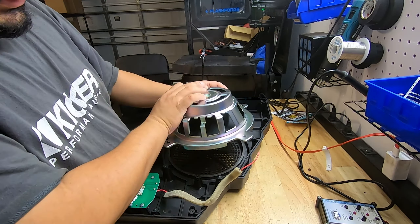Let's get this mounted. Normally when we mount the subwoofer, we slide it into the bracket, line up the holes, and screw it down. The problem with doing it this way is there's going to be a big gap between the bracket and where it's supposed to screw to — we can't have that gap. It's going to push us up more and won't allow us to use the factory hardware. So what we want to do is install it the other way, feeding the screws from the back to the front. I'm not sure if these screws are going to work for that purpose, but I'll test it and show you when it's done.